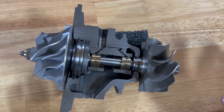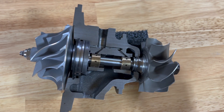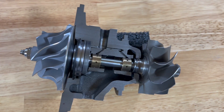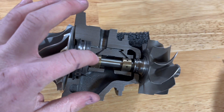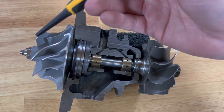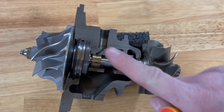However, if you have your crankcase vent routed to the atmosphere, or if you have an older truck that does not have the crankcase vent routed into the intake and you do have oil on the compressor side, here are some common issues. The number one cause would be when the turbocharger makes a vacuum inside the intake and pulls oil through the seal. This typically happens if you have an air filter that's inadequate for the airflow — if the turbocharger or engine is very large and the air filter is small and restrictive, it will pull so much air that it creates a vacuum and can pull oil directly through the seal.